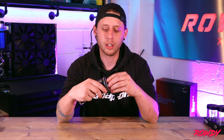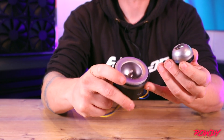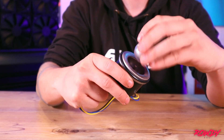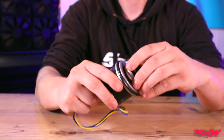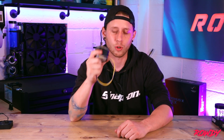Now the good thing about these pumps is the way they work — they're really quite smart and very reliable. They have an electromagnetic motor and they rely on centrifugal force to lubricate the pump. Basically the way that works is the impeller is quite hard to get out because it's magnetic, and there's a bowl in here with a small ceramic bearing. When the impeller is spinning, it will be buffered by a thin layer of coolant around the bowl, and that actually lubricates the pump and also cools it down. That's one of the key differences between the D5 and the DDC, as the D5 runs solely off water — it uses the water to cool itself. The DDC requires water and air, and that's one of its drawbacks, but we'll get more into that when we go through the DDC pump.